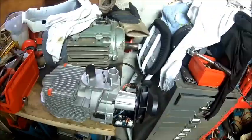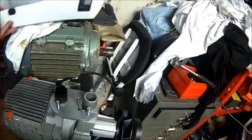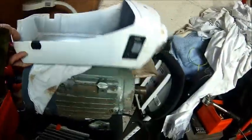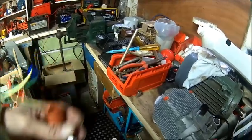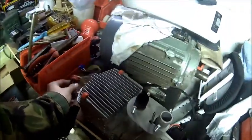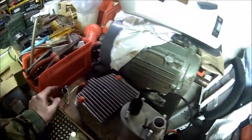Welcome back. Today we're gonna look into our Chinese diesel heater. I took it already out of the case — it's pretty simple. Pull the rubber at the bottom, push it backwards and then you can take the whole thing out. The problem we have is that the glow plug is broken. I had issues with starting; it doesn't start anymore and it was stinking like hell. I pried the prong off here and had it in my hand — I think it was knackered already, maybe transport damage, so I need to find one.